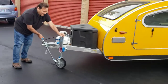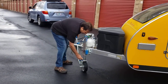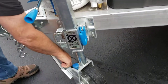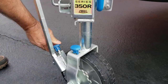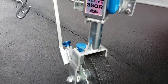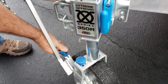Now I have an incline and the trailer is much more difficult to push along, so I'm going to reset this ratchet. You set them — I want to go R for reverse, so I'm taking both knobs and putting them so they face each other. This time I'm going to set them F for forward, and that's going to give me a ratchet going the way that I want to go.